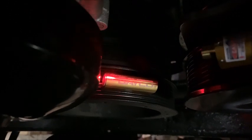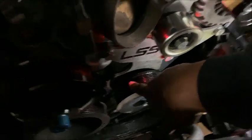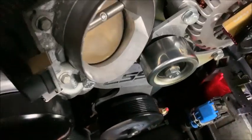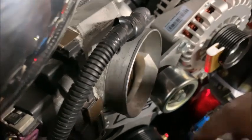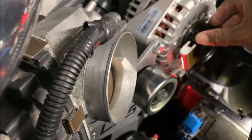Once we move the steering pump pulley inward a little, let's check alignment. The target needs to be right in that center — and look at that, right in there, right in the center. The steering pump pulley is now in alignment with the crank pulley. We tilt it up, move it back, and put the target on the alternator to check that too. As you can see, with the steering pump pulley in alignment with the crank pulley, the alternator pulley is also in alignment. We're good to go.